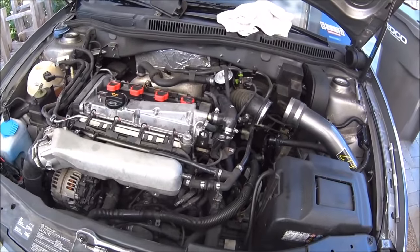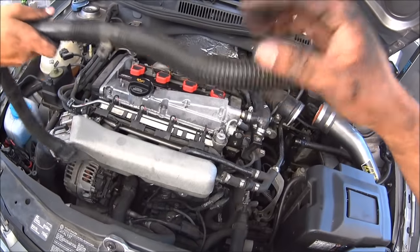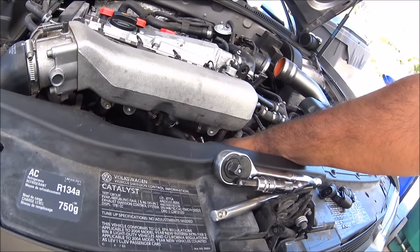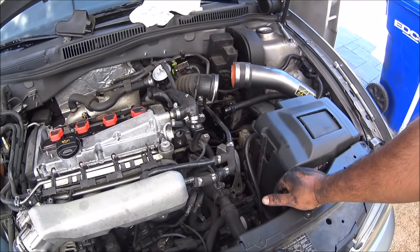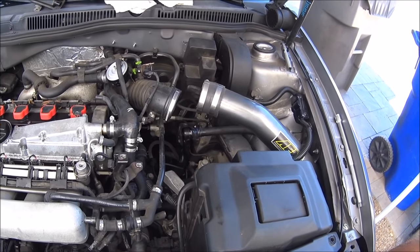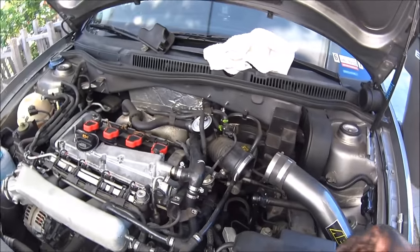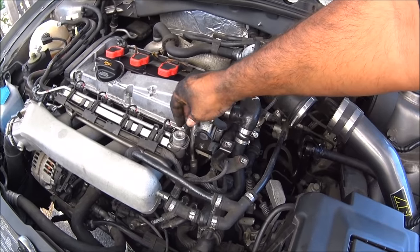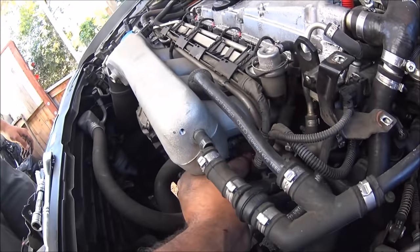Next we're going to be making a new vacuum line to get rid of this here. You can use the upper one or the one that's down below — it's up to you and how you want to use it. It's just a matter of how clean you want the install to be or if you just want it quick. You don't require both vacuum lines for the brakes — it just requires one. Just Volkswagen over-engineering things like always. You probably want to replace the vacuum line on the fuel regulator just because it's part of the original one he has right now — who knows how long that's been there. So you want to replace that, which is down below — it's probably brittle.